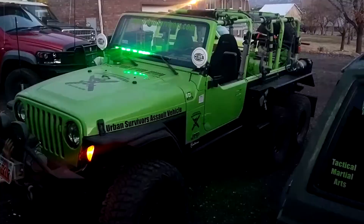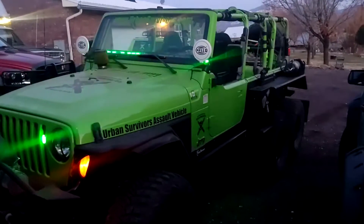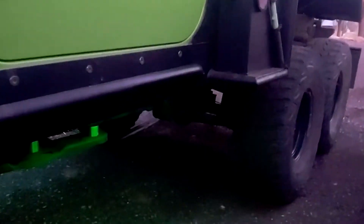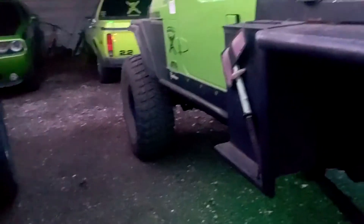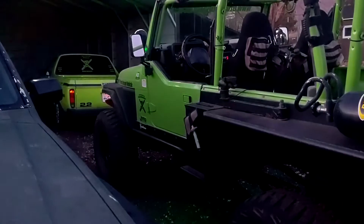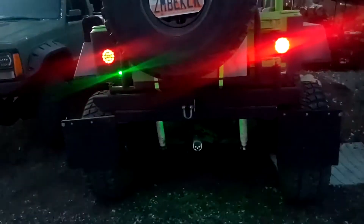Let's give it a test drive. We just took the Zombie Killer out for its first test drive with the new Trailworthy Fab Hero two-speed transfer case, and it drove very smooth. With this new setup, when we're in two-wheel drive, the middle axle is the one that's powered and the rear and front are neutral. When we shift into six-wheel drive, it locks the front, rearmost, and middle wheels for true six-wheel drive. It has Detroit Lockers in the back and an Eaton E-Locker up front.